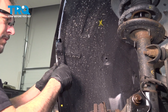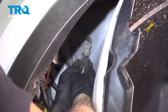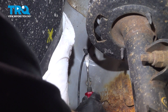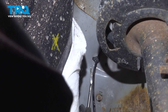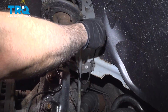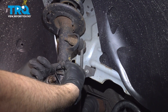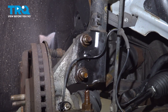With those screws removed, we're going to peel this out. We're going to go behind the fender liner and disconnect that speed sensor connector. Find the little pinch tab on the top of the connector and separate that. Use your trim tool to get behind the retainer here and pull that out. Pull that out at the strut as well, using our trim tool to remove that from the strut.